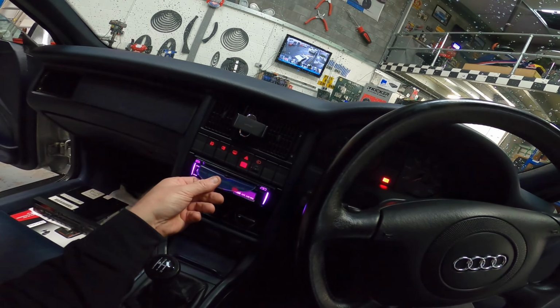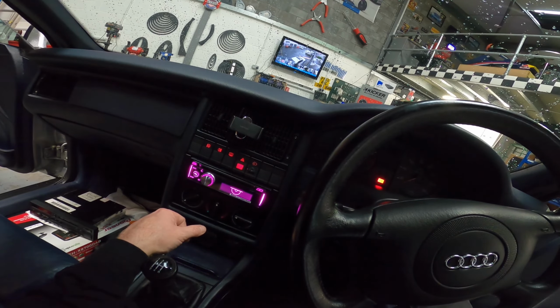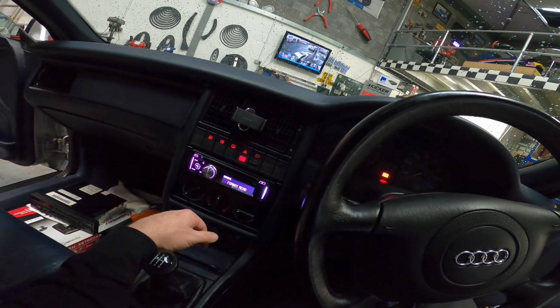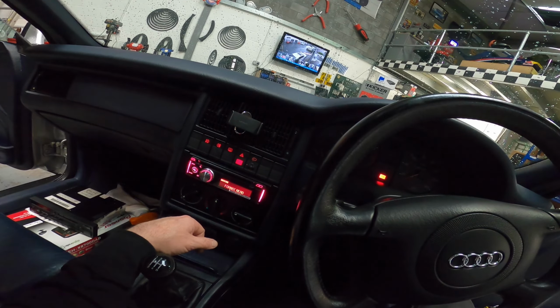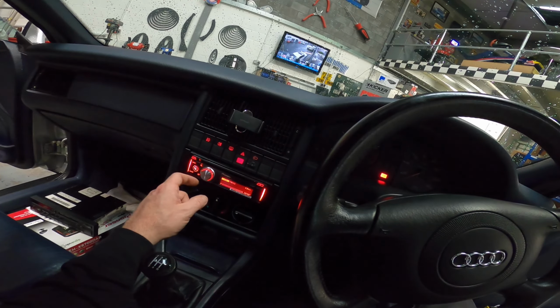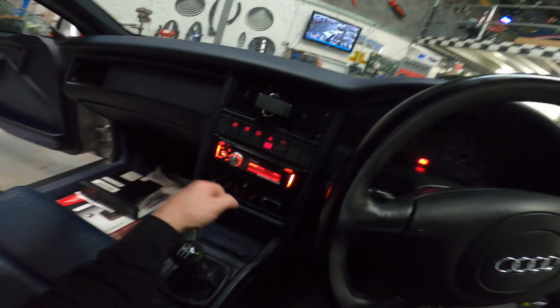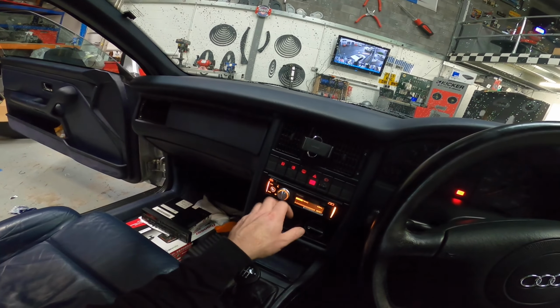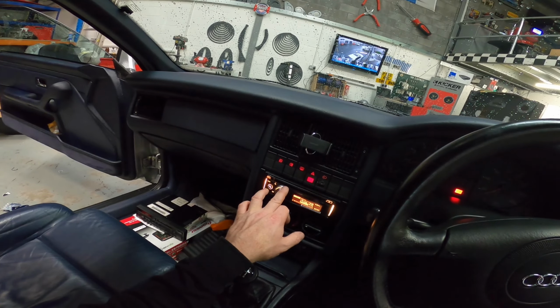He's in. CD wasn't playing, I don't know whether that was just because it was a bit damp and a bit cold. Still got a label on which says it's new, but I don't know. There was a CD in it, so I'd say that's a second-hand head unit. But it did come up with E11, which means a CD mech error, so hopefully it's going to start working. Old radio's gone, got our little fascia adapters in. Sounds alright.